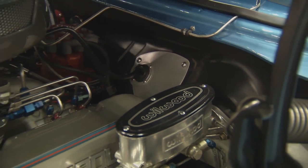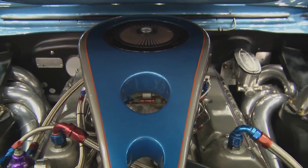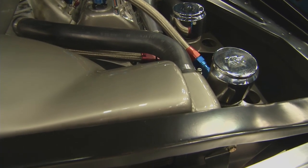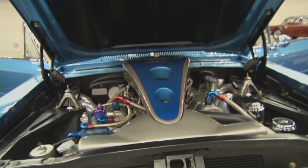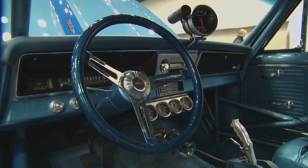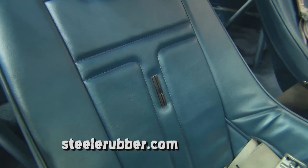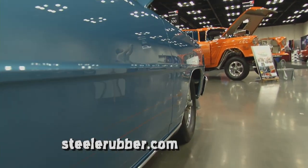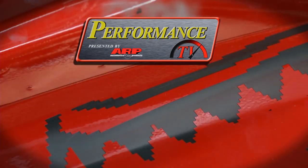The engine's a 598 big block Chevy, and trying to put an engine that size in an engine compartment that small is quite a job. I had to hand make an oil pan, make custom motor plate and mid-plate mounts, and notch the shock towers to get the headers to fit. The front radiator cover and air cleaner is a handmade piece out of aluminum - a lot of people think it's fiberglass. The steering wheel is an original metal flake wheel that we restored. The seats are jazz race buckets with stock Chevy II medallions. I wanted to give the car a muscle car feel but with race car fundamentals.